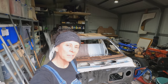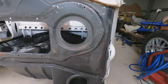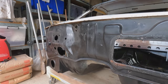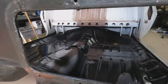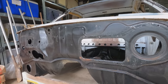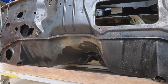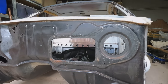Next for the HZ1 Tonner is the firewall and underneath the floor. I'm going to strip all of this paint off. I don't think there's any rust problems here, but you never know until you start stripping the paint off. I'm going to give it a KBS treatment as well. Having learned from doing inside the floor, the best way to apply this so that it doesn't get runs and paintbrush marks — I'm going to have a go at doing it on the firewall. Worst case is I just have to sand it back a little bit and then just paint it with whatever I use on the inner guards and anywhere else in the engine bay that needs to be black. As for underneath the floor, Trixie has to get flipped on her back for that, and that's imminent, but I just figured I'd have better access to the firewall while she's upright. So that's the plan today: strip the firewall back and get that ready for KBS.